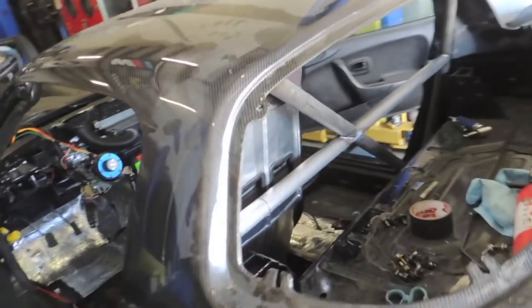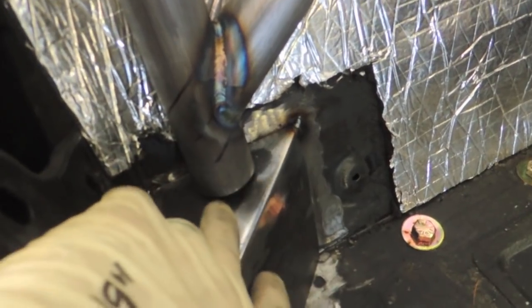Main hoop's welded up, looks really nice. I think I'm going to have to drop it just a little bit because I've got a gap where the tube isn't sitting flat. Dropping the cage down a touch will also give the roof just a little bit of room for the seals to compress and everything to move so it's not squeaky and rattly.